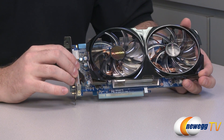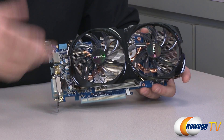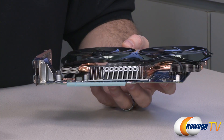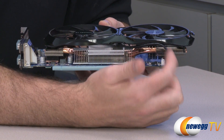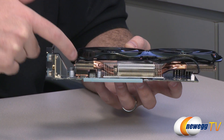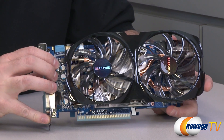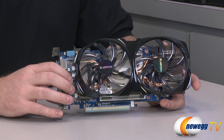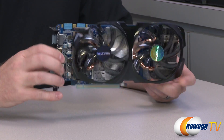This is in the Windforce family of aftermarket GPU coolers from Gigabyte — the 2X version with two large fans, ranging from two fans up to five fans on some of their super overclocked models. Looking at it from the side, you have a large array of aluminum fins. The GPU is right beneath that, pulling up heat. You also have copper heat pipes, two on each side, providing heat dispersion out to the fin arrays. One fin array also makes contact via a thermal pad with the MOSFETs for power delivery cooling, which is very important for the 600 series because keeping the card cool lets GPU Boost reach higher speeds.